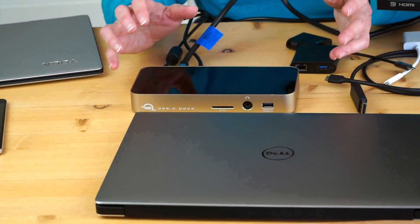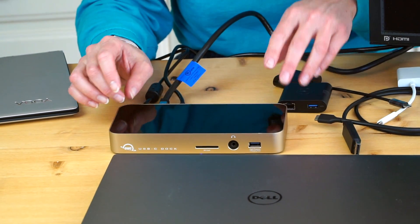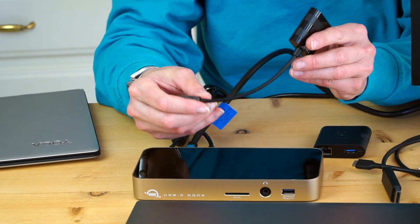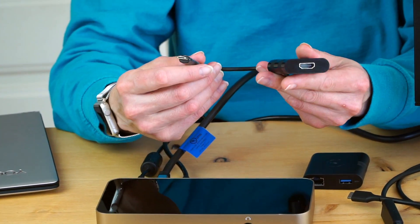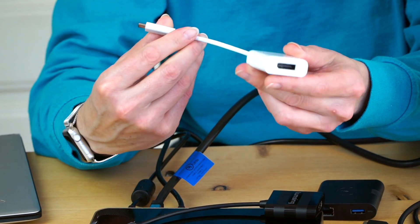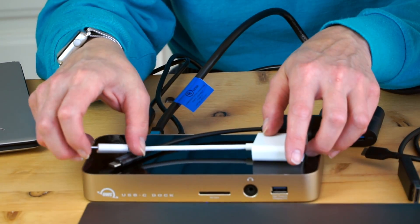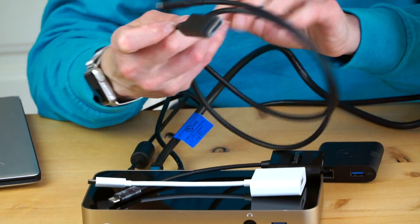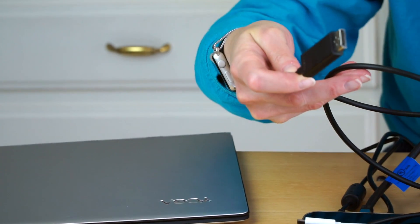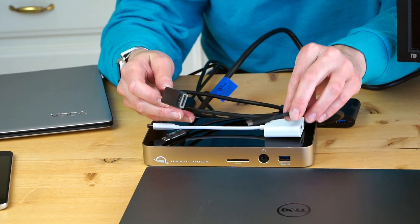There's probably custom firmware in this dock that's meant to work better with the Mac than with anything else. However, there are adapters you can buy that work with both the Mac and any USB-C Windows 10 machine. For example, a Lumsing HDMI adapter lets you go from USB-C to HDMI. There's a Monoprice USB-C to DisplayPort adapter that goes all the way up to 4K at 60Hz — assuming your computer supports it, which pretty much every computer shipping with USB-C can.